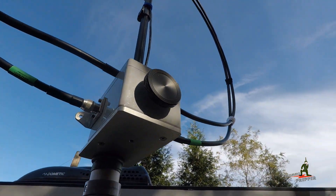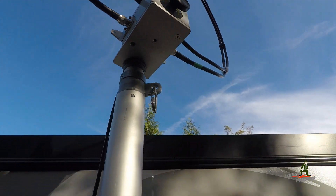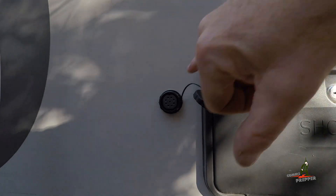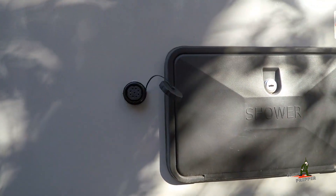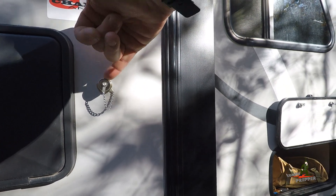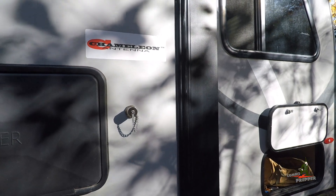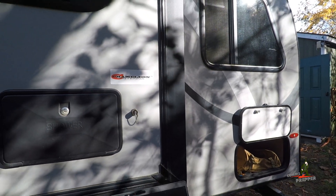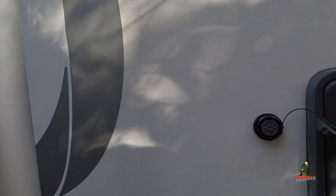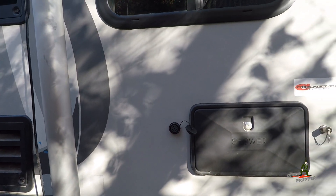When I add the remote tuner, the manual knob will be removed, the white adapter will go on the front, and there will be new wire. I've also been making some modifications to the camper — I added a 9-pin cannon plug for my Starlink dish and an N-type connector so it can be waterproof for accessing antennas outside the camper, allowing me to operate from inside. I'm probably going to make one more penetration into the bump-out for the remote cable of the remote tuner.